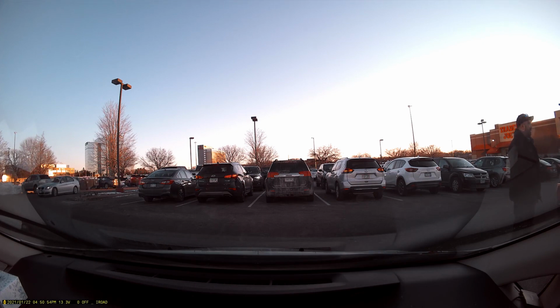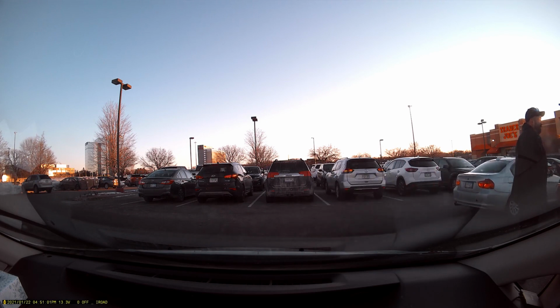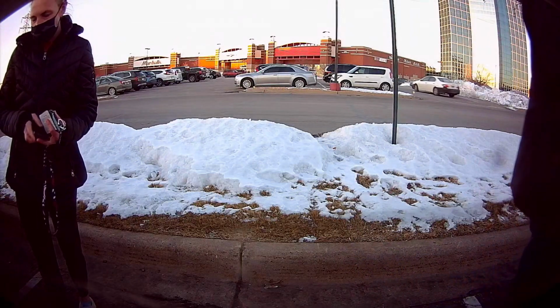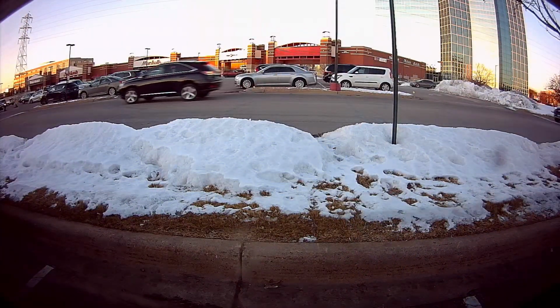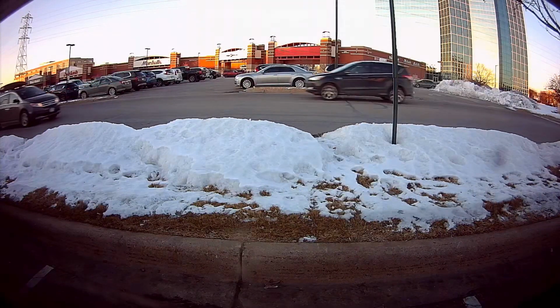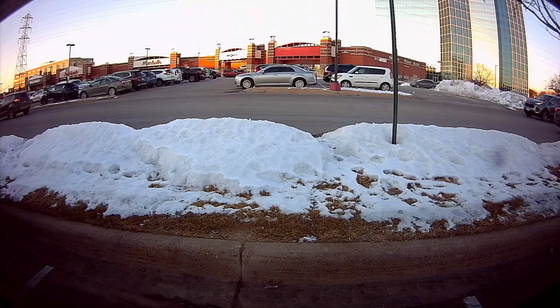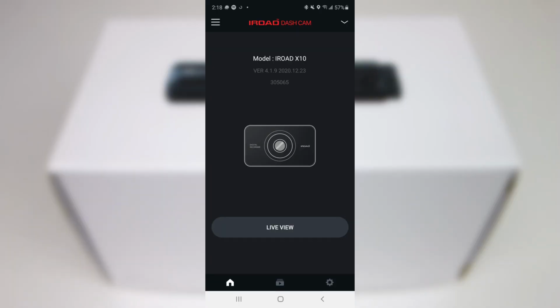built-in timer function. Viofo doesn't offer that currently, as far as I am aware either, but with Blackvue and Thinkware, the benefit of that is if you park for several days at a time and don't want to just run down your battery to 12 volts or whatever your low voltage cutoff is, then you can set it to, say, 6 or 12 or 24 hours on those cameras, and then it'll shut off. With this, it'll just keep staying in parking mode until it gets to that low voltage cutoff or that high temperature cutoff. Now, the app for this camera is pretty interesting.